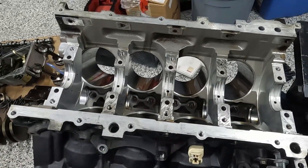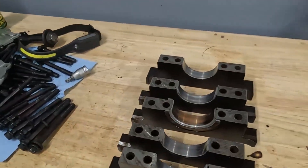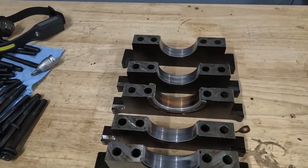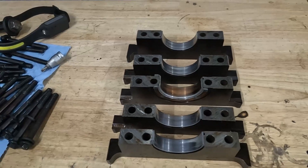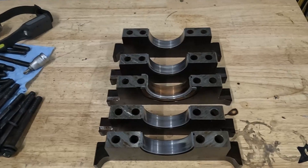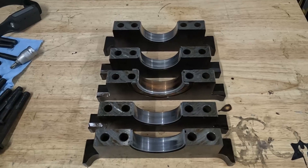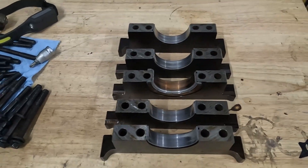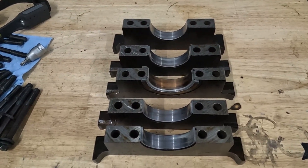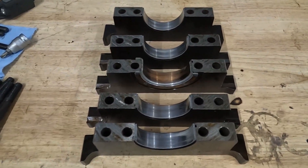But really I think we just found the limits of the stock crank. Near the end of the season we were between 20 and 25 pounds of boost with that S480. I'm not sure on horsepower, but we were over 1,000 pounds per hour on E85 measured at the Holley. When we dynoed it we were at like 850 pounds per hour and that was 720 wheel horsepower — and the car was still spinning on the dyno so we were putting belt dressing on it. I would say we're definitely over 1,000 horsepower flywheel — maybe 1,050 pounds on E85 — I'd think it's got to be over 900 wheel, but it's impossible to know without having dynoed it.